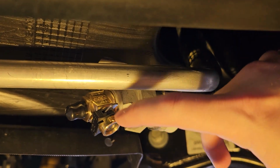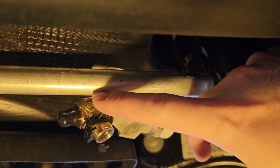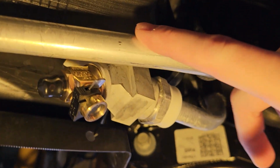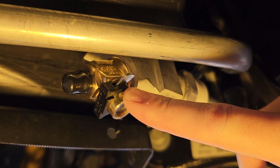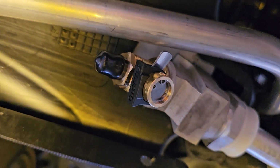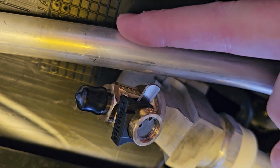That's because this nozzle that sticks out here was actually sticking out at 90 degrees and poking right where this hose needs to go, where this line needs to go here. So I did have to rotate this entire fixture an additional 90 degrees past the 20 foot-pound mark so that I could get this to point down and have plenty of clearance. So I have at least half an inch of clearance, so it's not rubbing on this at all.